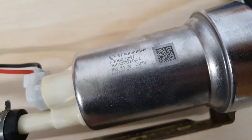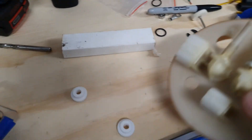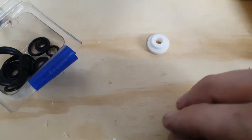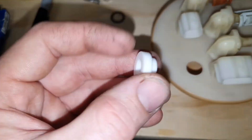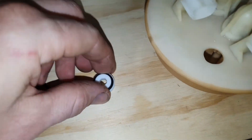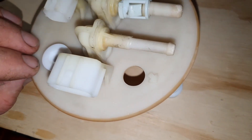This is a TI Automotive pump, made in the USA. I took a break and decided not to go the way I was going in terms of rewiring the fuel pump. I've decided to go with actually hard wiring through the actual hat itself, so I've drilled two holes out. I've got these little bulkhead fittings - you carefully drill the right size hole, and you get two of them that come with a ring, putting one on each side.